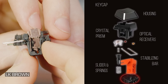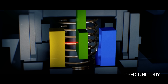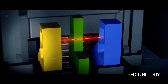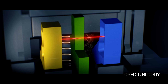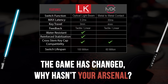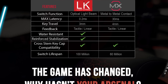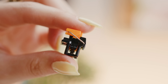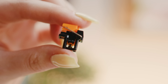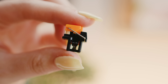One of the stated benefits, according to Bloody, is that because there are fewer parts that have to touch each other compared to a traditional mechanical switch, along with less metal that can oxidize, the LK switch should have a longer life — with Bloody claiming you can get over 100 million keystrokes out of it before it would finally wear out. This is partially thanks to a stabilizer bar that reinforces the keys and also prevents them from becoming mushy after long-term use.